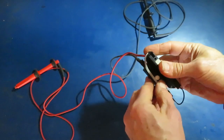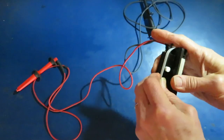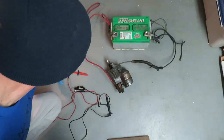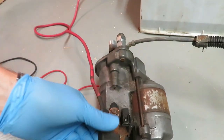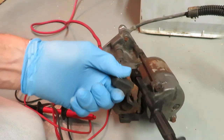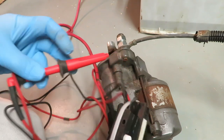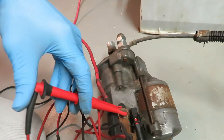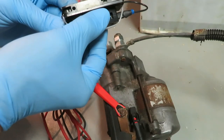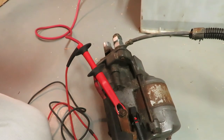Okay, let's pop this back together then and get a hold of a starter to test it out. I've wired a good used Dodge Caravan starter to a battery directly, and now we'll just plug in the remote crank switch — one lead to the S terminal and the other lead to the big battery plus terminal. Looking good.